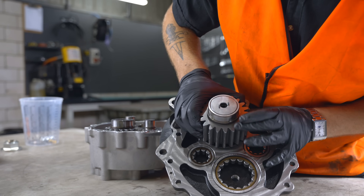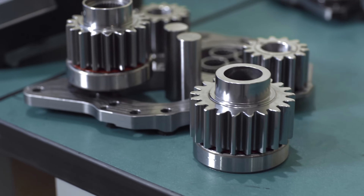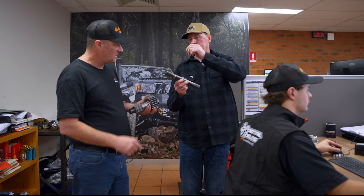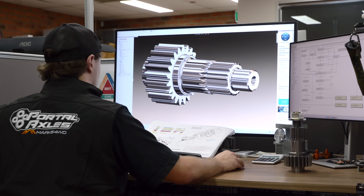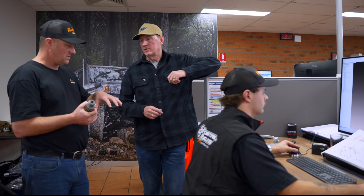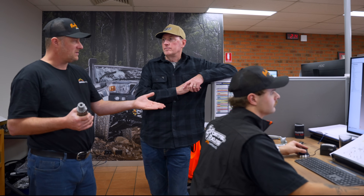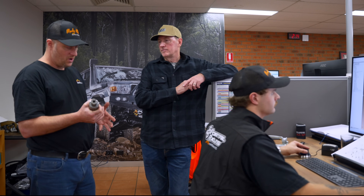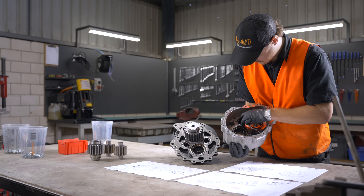One of the biggest changes we've done is the output axle. We've increased the width of the gear by approximately 10mm. The output axle itself is now one piece, whereas previously it was a two-piece axle — because that's the short axle from a traditional portal setup. Our limitation was the OEM Toyota wheel hub and bearing combination. You've got the Toyota wheel hub, the bearings and the spindle, and that axle has to go through that spindle — so you can't make that axle any bigger. The complete changes we've made now allow us to run this massive axle and the big internal twin-row wheel bearing with a seal, making it maintenance-free.